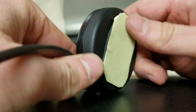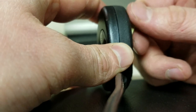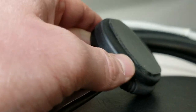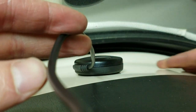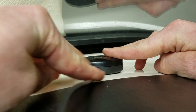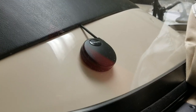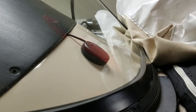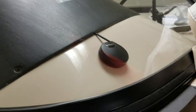Next step is to mount the GPS. I got a little double-sided tape with a bit of foam in there. Peel it off and place it down here, push it down, and this wire is going to feed underneath the dashboard. The Garmin GPS is attached to the paint — no obstructions, so it'll shoot straight up. I like how it sits underneath the windshield to protect it from water splashes or debris, so the GPS module stays protected.